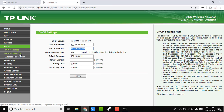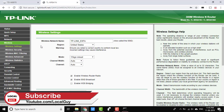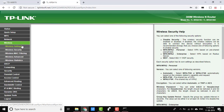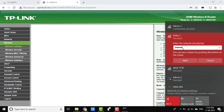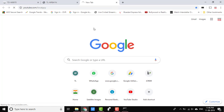Here I have applied the 192.168.0.0 subnet — start IP is 192.168.0.100 and end IP is 192.168.0.199. Any device connecting to the extender router will get an IP address from this range. My laptop got IP address 192.168.0.100 from this range. You can change the SSID name under wireless settings and the password under wireless security. Here I have changed the SSID to delta1. Reconnect to the new SSID delta1 using the default PIN given on the router sticker, then check the internet connection — and yes, it is working.